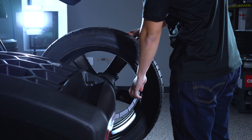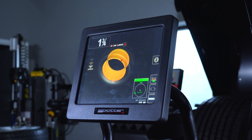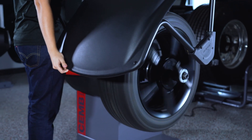This is a 3D wheel balancer, so it automatically takes distance, diameter, and width on both steel and aluminum wheels. It also features our auto-adaptive one-plane balancing software that adjusts tolerances based on the wheel you're balancing, and saves you time by balancing the wheel statically and dynamically with just one weight.